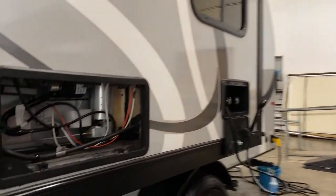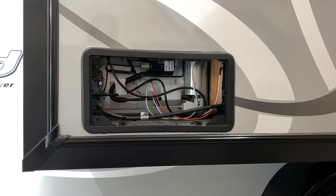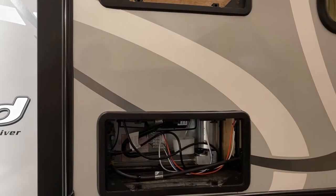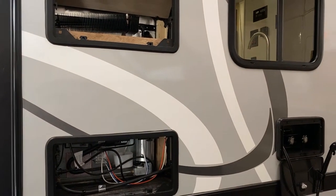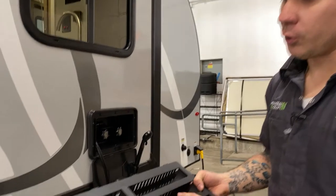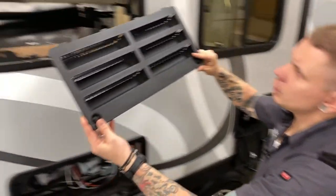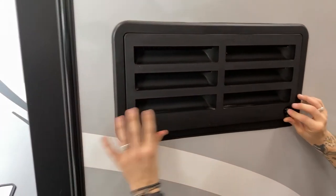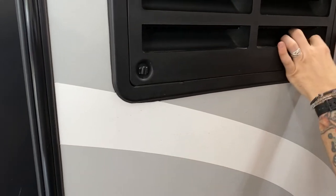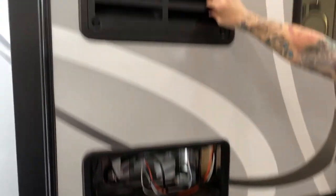For the refrigerator, not too much maintenance is required — it is not considered a customer-serviceable unit. Give it a visual inspection a couple of times a year: make sure nothing has gotten in or is nesting, and check for frayed wires. It is also a large intrusion point for mud daubers and flying insects, so screen both the top and bottom vents. When putting the vent covers on, put the tabs up first, line up the holes on the bottom, and give them a quarter turn to lock.